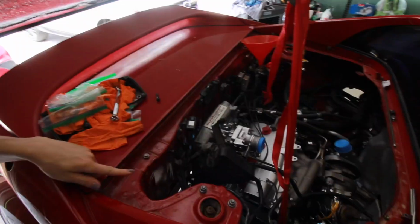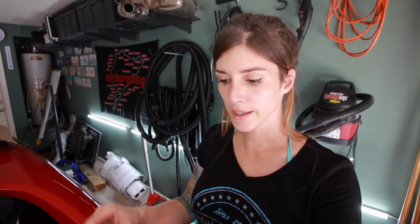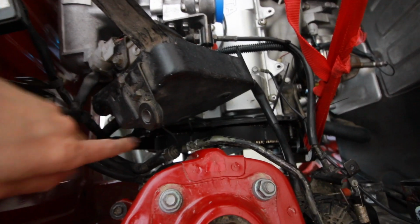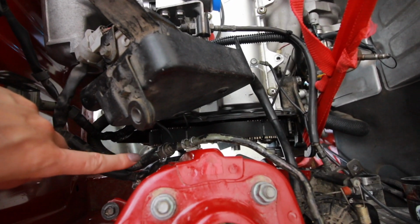Hey guys, today is a Mr. Dose day. This guy right here. So here's what we gotta do with Mr. Dose. First things first, gotta get the timing belt back on. Once the timing belt is back on, the motor mount on this side, engine mount on this side, can go back on along with the plastic timing covers, intake manifold, and a couple other little miscellaneous things.